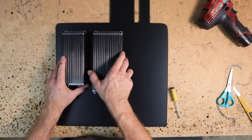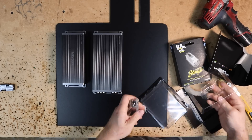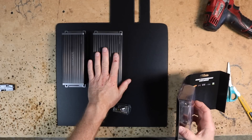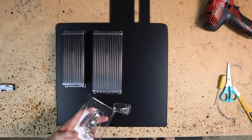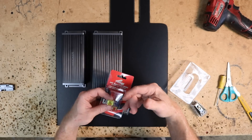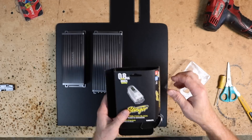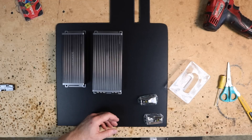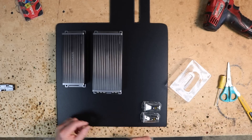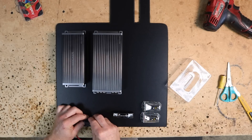Get the amplifier spacing the way we want it — the signal is going to come down this side like we said. We have some distribution to deal with because we're running one power wire, so we need to add in some fusing. According to the manufacturer, this one takes a 20 and this takes a 60, that's 80 amps total. The problem is we typically only stock mini fuses, and the smallest I can get is a 30. Maxi fuses go down to a 20, but I haven't stocked any maxi fuse holders since the early 2000s. We have two Stinger SHD20 power distribution blocks — zero and four inputs, four and eight outputs. Plan is to put these two here so I can run power and ground into them, plus this small fuse holder for this amp's power and the fuse holder that comes with the amplifier mounted here.